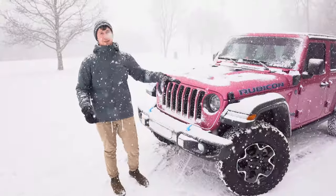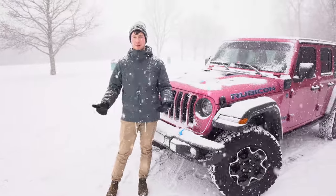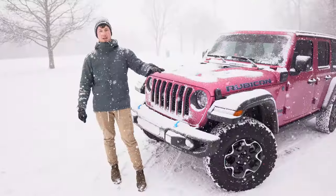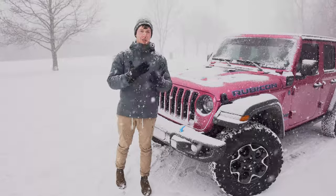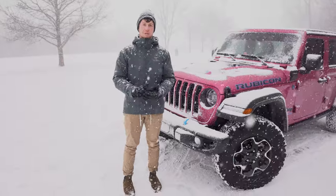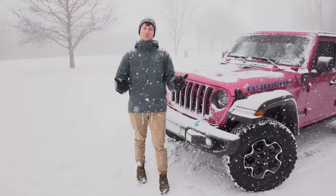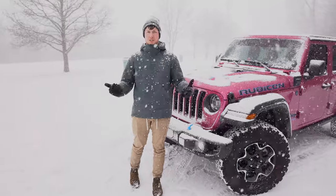Now that you know the tech behind the full-time four-wheel drive system, you might say that sounds more like a Grand Cherokee or an Audi Quattro — an all-wheel drive system — rather than a Jeep. I want to go to Moab or something. I promise you this thing has all of the blue-blood four-wheel drive in it that the white EcoDiesel Wrangler does. When you want, you can always put it in part-time four-wheel drive. Even though there's a clutch pack between the front and rear drivelines — there are clutch packs in your transmission, clutch packs all over — they can lock those things up solid. It still has regular four-wheel low, just like anything else, so it has everything you need out of a true Jeep transfer case, but it gives you a little more finesse and the option to not have to take it in and out of two and four when you're driving.